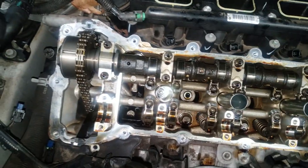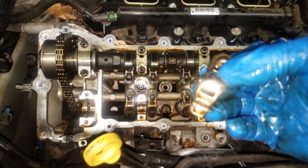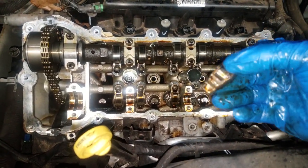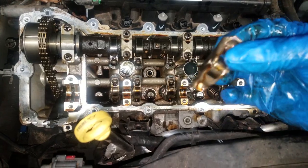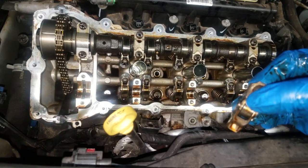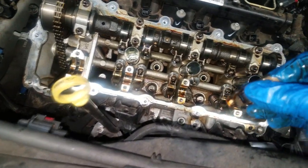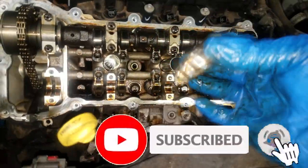Yeah, so that's where all your noise was. This could have been easily avoided — I try to tell people this all the time. Your first sign of noise, you should jump right on this. If you do it right away you will not eat into your camshaft and you'll save that extra money, but now you need rocker arms and a camshaft. There's no oil additive out there that will fix this — they simply have to be replaced. I'm going to end this video here. Thanks for watching. If your engine is ticking, get it done as soon as possible so you will not need a camshaft, and that will save you some money. Comment and subscribe and I'll see you on the next video.